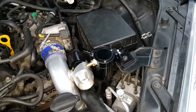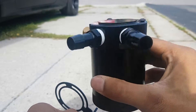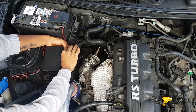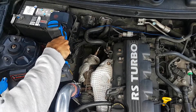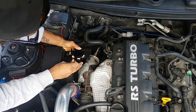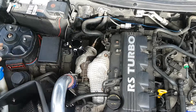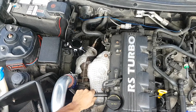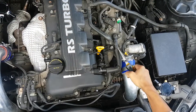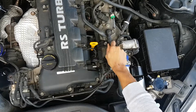Here's the mounting plate on the other side and the catch can — as you can see, they're both half-inch connectors. We start by removing the 10-millimeter bolts. Now take the mounting plate, hand-thread it on, and bolt it down. Put it to the extreme right, just like the other side. Get your needle-nose plier to pull out the existing hose. For the other side, you want to remove here and here, then slide it off.